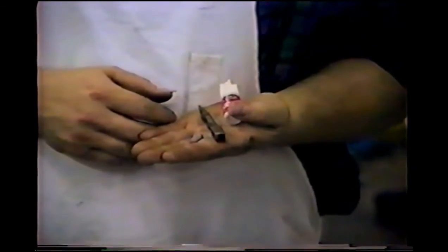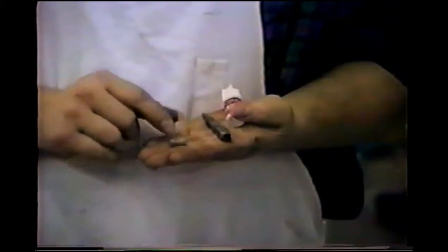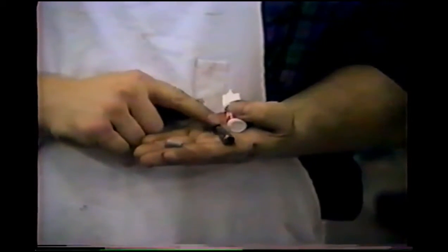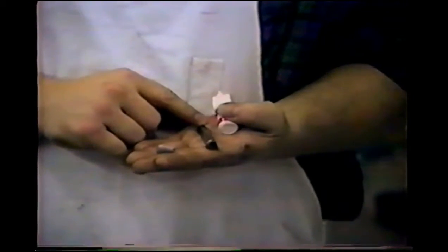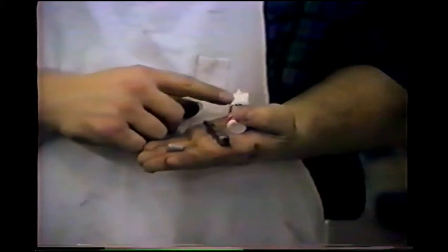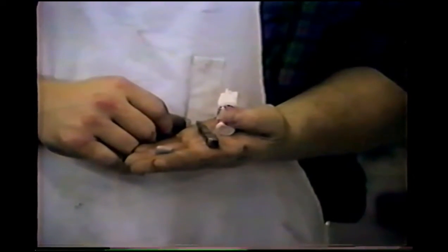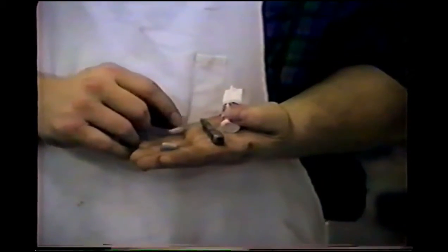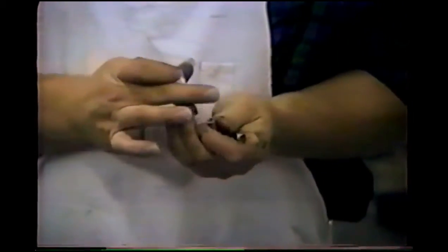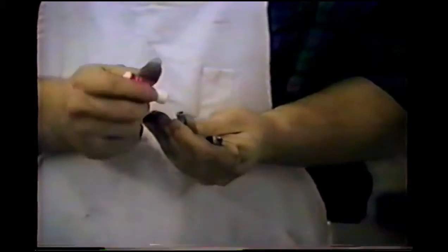This right here is all you need to make the tapper, this and a little bit of tape. This is just an electrical wire nut made out of plastic. This happens to be a 3/32 inch nail set. The size isn't particularly important. And a little bit of super glue. I use the fingernail type super glue because it's a little thicker and seems to dry a little faster than some of the stuff that comes in the little foil bottles. I'm just going to put a couple drops of super glue inside the wire nut.